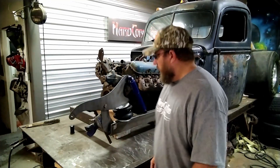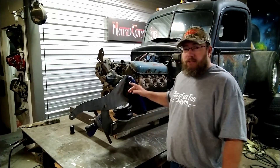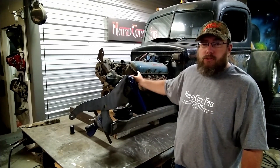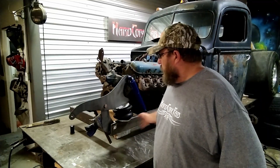After going back to the drawing board, I realized this little bag just isn't going to work. I need to have an actual full-size bigger bag that's going to give me a lot more travel. I ordered up a bigger bag — this one's a 2,600-pound bag with eight inches of travel. That other little bag only had about three and a half inches of travel. It was something I had already, so I was hoping I could make it work. But it just ended up pushing the axle too far forward every time I tried to rework it. It's already got an exaggerated front end sticking out farther than what it would be on any stock vehicle, and I just didn't want that being even more exaggerated. So I've got this new bag, redesigned a new arm, and now I've actually got about three or four inches of extra gap right here on the front. I'm actually thinking I might go ahead and cut the front of this frame rail off and redo the whole front, pulling it back in just a little bit more. I think that's going to have a look I'm going to like a lot better.